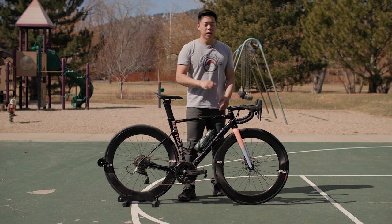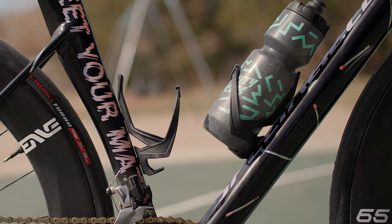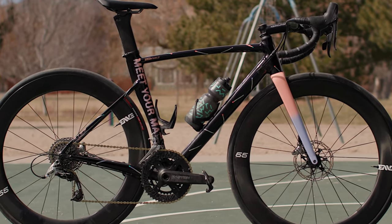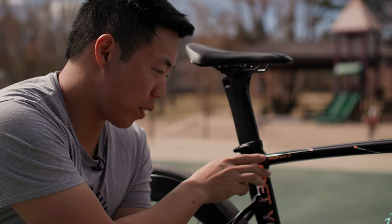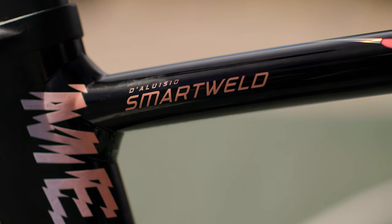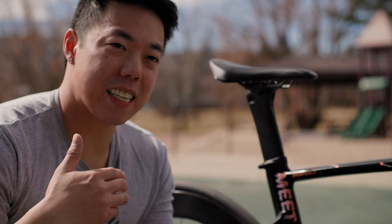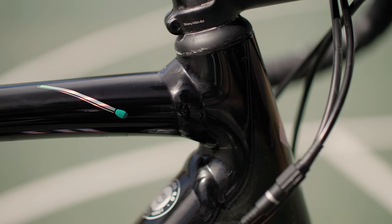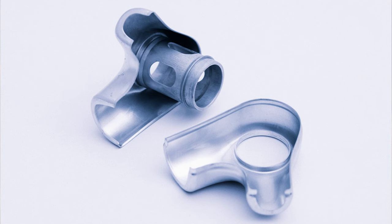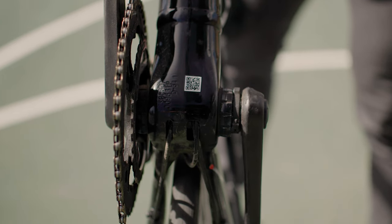They did two things that made this bike really special. The first is aero tubing — these hydroformed aluminum tubes are truncated airfoils and they make this bike more slippery than the first generation Venge. The second really cool thing is their proprietary welding technique — we'll call it SmartWeld. SmartWeld moves the positions of the welds away from the joint, which creates a stiffer junction and also removes excess material, making it lighter. You can really notice the SmartWeld on the head tube and at the bottom bracket. The bottom bracket is this hollow clamshell that's two halves, brazed down the center and then welded into the tubes.